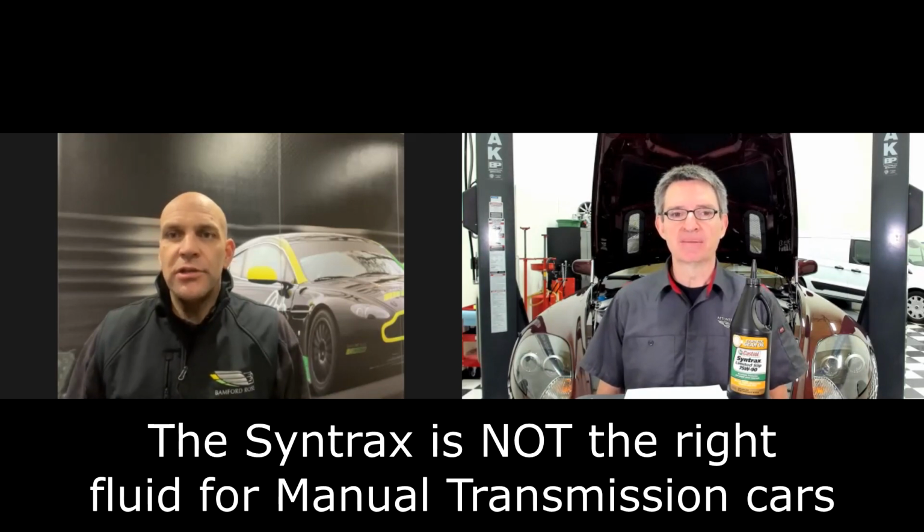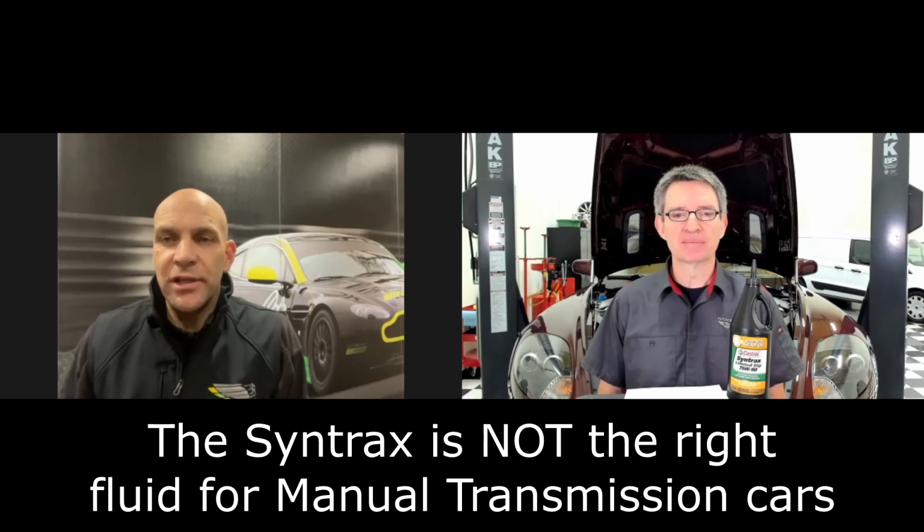Okay. So we use the Castrol BOT 270A in the DB9 rear diff and in the V8 gearbox. So this is fairly readily available here in the US. It says it's for limited slip, but you're saying the additive helps with the chatter from the diff?